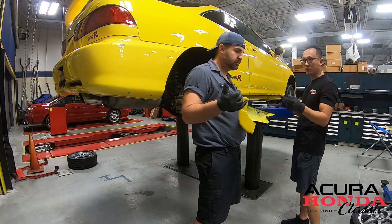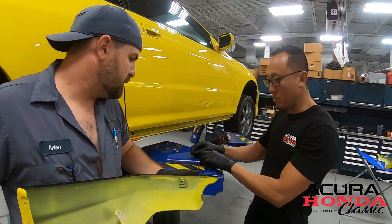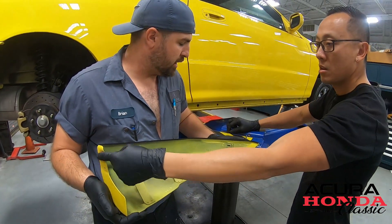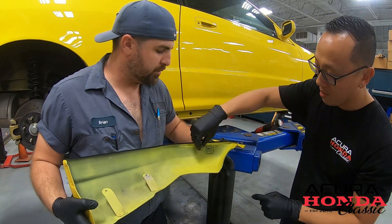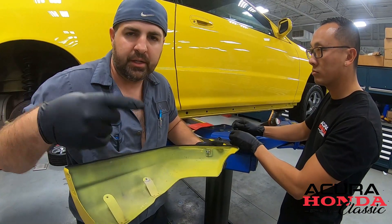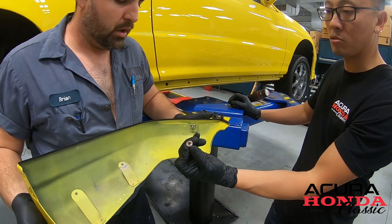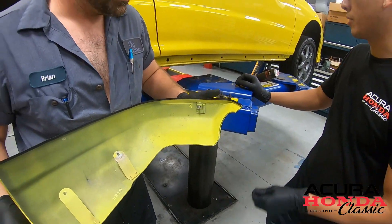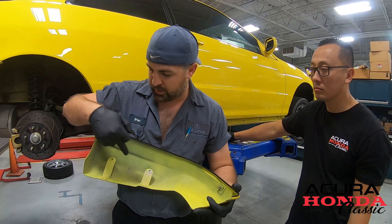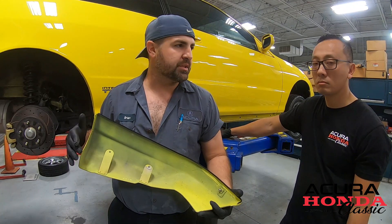We've got some hardware — we'll get this mounted around the bumper now. We've got a couple of bolts that mount up on the bottom, a couple of Phillips. Go to the side and then we've got another one here — that's a slotted one. And you've got a little room here if you didn't drill your hole 100% — there's a little wiggle room you can work with, designed for it. The factory OEM screws with the washer. The way this installs is it installs from the end first — this fits into a groove. We hook this one from underneath and then we'll finish these up last. Put everything in loose first and then tighten it down.